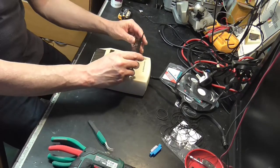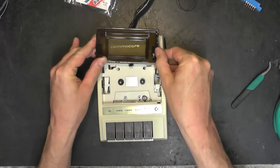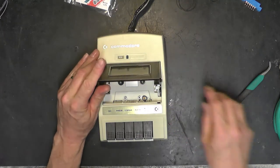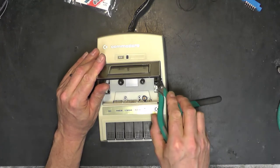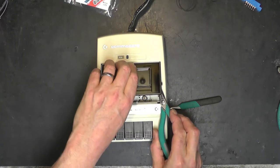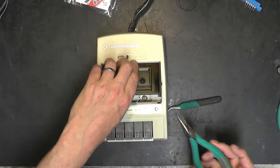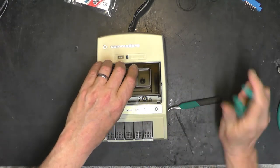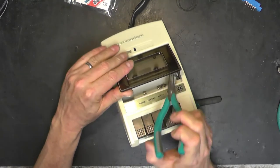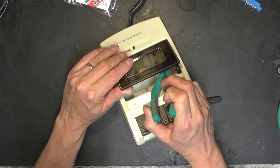Right, the lid goes in like that. Now this spring, don't forget, has to sit in this groove here. So just get it all sort of lined up a bit. Make sure that spring is going to run in that groove, okay. I'll hinge that in after we've got these side pieces in. I'm just going to squeeze up slightly. Yep. Then I can tuck the spring round with this pair of needle nose pliers.